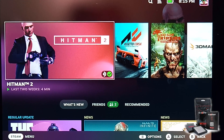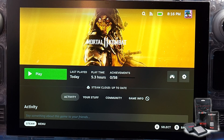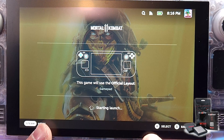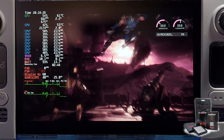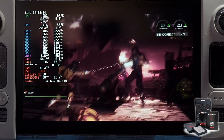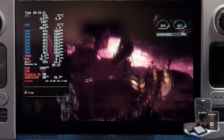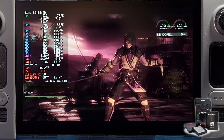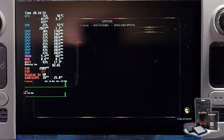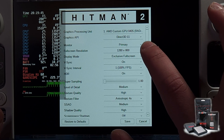Now with the cryo sheet applied, we're going to put the cryo sheet image at the bottom right, indicating we are testing with the cryo sheet applied. Let's see if temperatures improved. Right off the bat, looking at the numbers on top, the GPU numbers are going really high — talking about 74°C — while the CPU is staying within the 50s. When we had the liquid metal applied we saw better numbers, so this is not looking good. Let's take a look at the Hitman 2 benchmark with the cryo sheet.